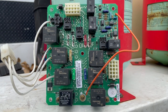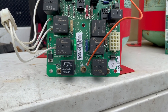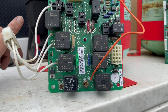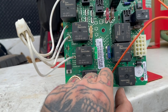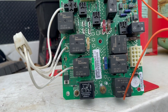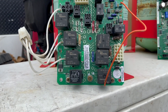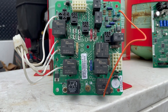This is the actual fuse panel in the back side of the cabinet. It's self-explanatory — it says on the actual board F6, F7, F10. When I show you the diagram it'll show you the exact same setup along with what they mean. These should all be 30-amp fuses. These three fuses right here control your actual evaporator fans. I replaced this one and everything's working properly. At the end of the video I'll show you the diagram of what controls everything.